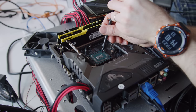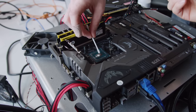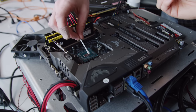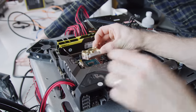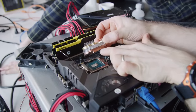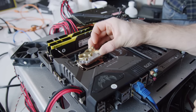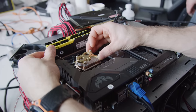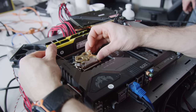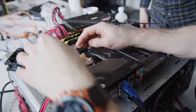So we apply this right in the socket. That's a lot, yeah? You can sort of get it in there and then just pull out and it'll deflate. It's really weird. So this is the trickiest part. You can see this notch is smaller and it's offset compared to the one that's built into the integrated heat spreader. That is so that you can kind of start it over here, move it to where it will actually be held down, and then tighten the whole thing down. This is crazy!